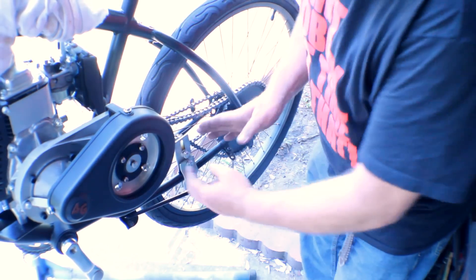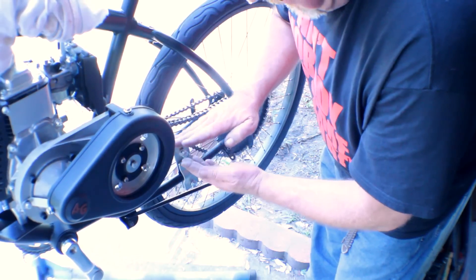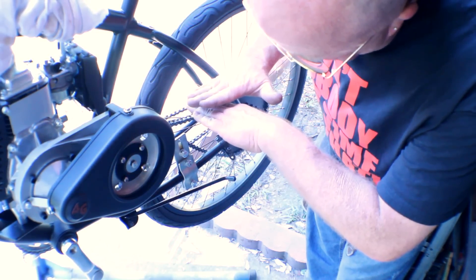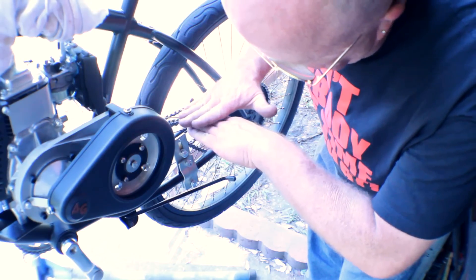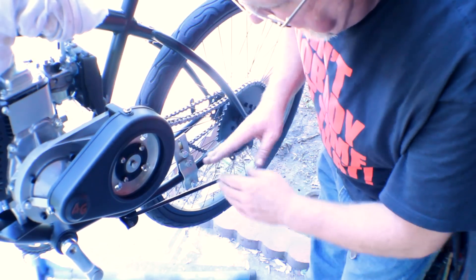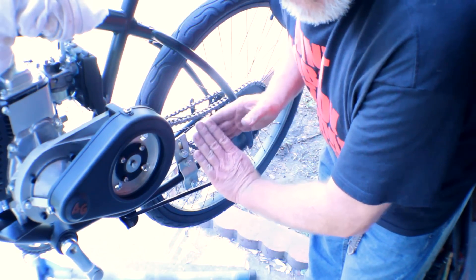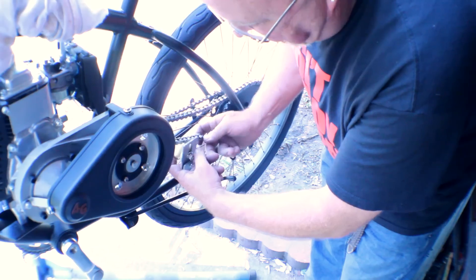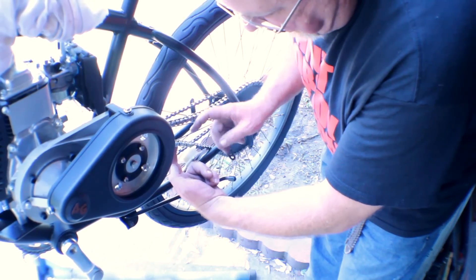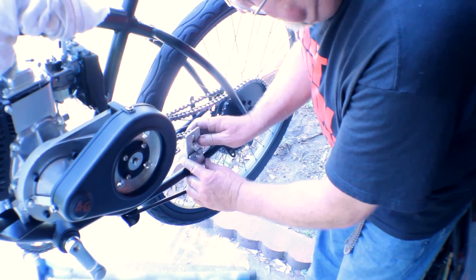You don't want your arm tilted in to where the wheel isn't riding flat against the chain. Your chain is flat, and the flat of the wheel needs to make good contact with it — you don't want the wheel cocked in or out. If you push it in it will try to push the chain in, which you can use to fix minor chain rubbing issues, but for the most part you want the chain flat against the flat part of the wheel. I'm exaggerating to show the point — if it's pulled out too far there's no way it will ride properly. Get it flat against the chain, then slide the tensioner back.